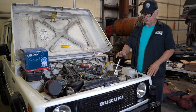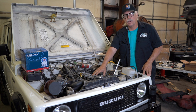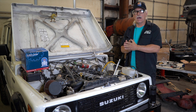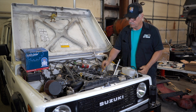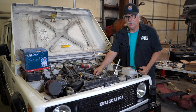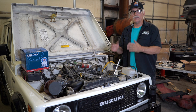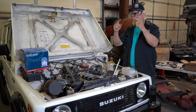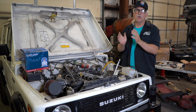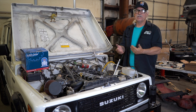What we're doing right now is putting the engine up to cylinder number one. How do I know that cylinder number one is up to the top and ready to pop? It's going to have a loose intake rocker and a loose exhaust rocker. The only time the valves are closed when the rockers are loose is because it's ready to get a spark — we want it in that condition. So the valves are closed and the piston is up.